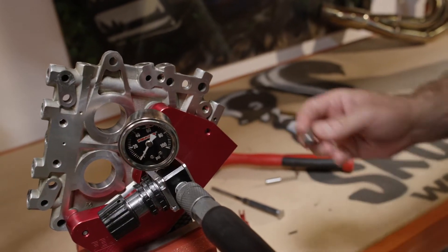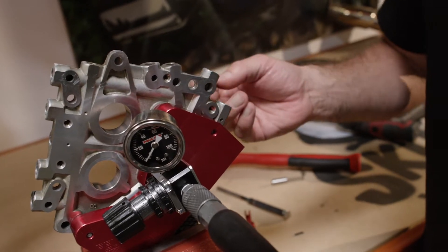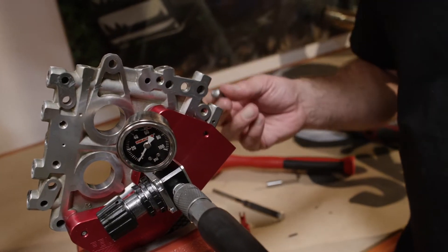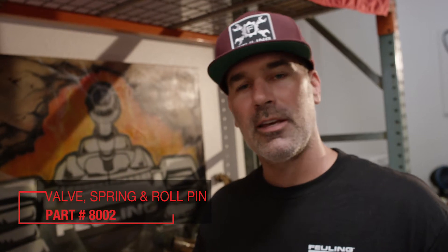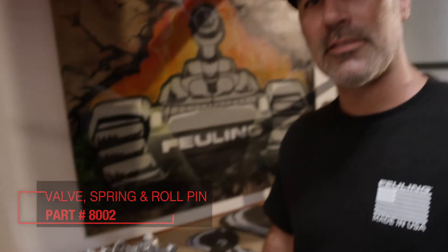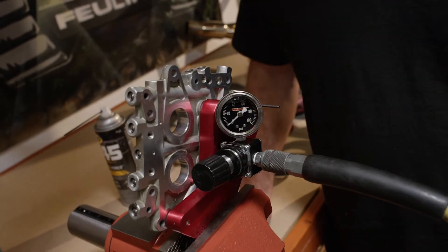Repeat the process with the plunger — tapping it with the punch and the hammer. We'd like to see the valve seated and sealed from 0 to 30 psi at a minimum, with a full pop-off in the range of 55 to 60 psi. We've reamed the factory cam plate using the Fueling reamer and installed the Fueling pressure relief valve and spring. We have a kit that includes the valve, spring, and roll pin. The cam plate is now seated and sealed with a full pop-off in the range of 55 to 60 psi.